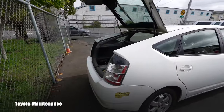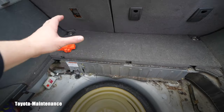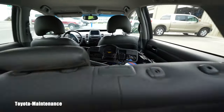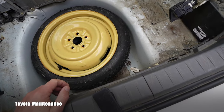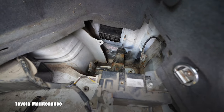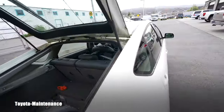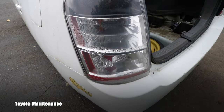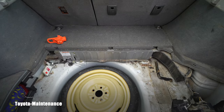P3030 means there will most likely be a complete interruption of the wires between the battery cells and its computer, or there will be heavy corrosion. I already removed the paneling — the spare tire was floating in approximately three inches of water, and the small 12-volt battery was floating in approximately two inches of water. This vehicle was flooded, likely due to winter rains leaking inside.